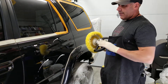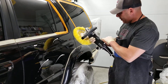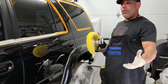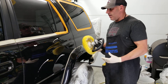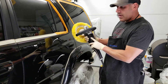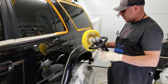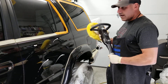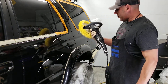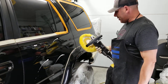Arm speed and tool speed are both techniques. If I was just starting out I'd run this machine as low as possible — the number one setting — which with Rupes is 450 RPMs, super low. The DeWalts and Makitas go to 600 RPMs. This machine goes from 450 RPM to 1700 RPM. I just got this machine, it's pretty much new — I can't say enough about Rupes. They're made in Italy, super durable, torquey, high quality.